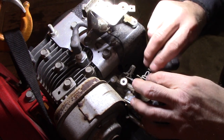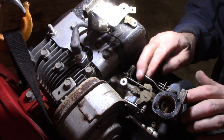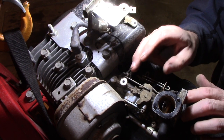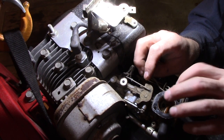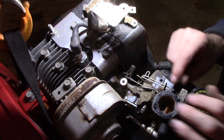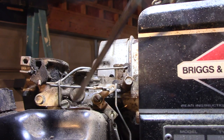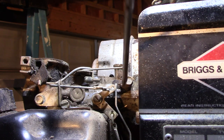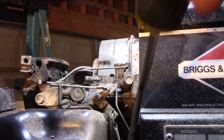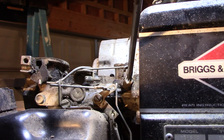So this piece — there's going to be a kill switch wire in there, and there should be enough room to just tilt this forward and get this thing off the Z-bend. Let's just drape it on this side and leave that there. Take all your pictures because where this Z-bend is, there's only one hole for this choke lever. Look at how rusty it is in here.